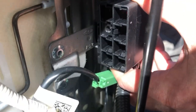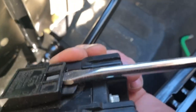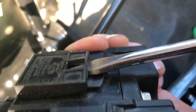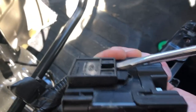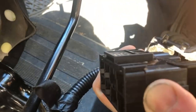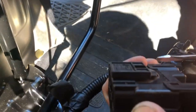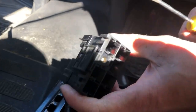To remove the housing from the bracket attached under the seat, there is a trick. A flathead screwdriver will fit under the tab on the back of the housing. When you put your screwdriver in there, it forces the other little plastic tab up a little bit, releasing pressure on the bracket so that the plastic housing can slide out.